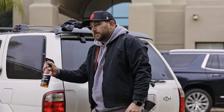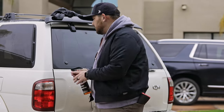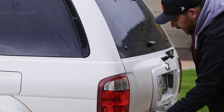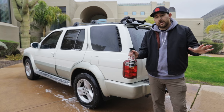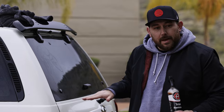Set my pressure washer down — I'm going to need that in a second. Then take the iron remover and blast the paint down. Mainly the paint; you don't really need to do the glass because iron will stick to it but won't embed itself. All the area I dried, I blast off with iron remover. The iron particles embedded in the paint start to react with the thioglycolate — the same chemical used in wheel cleaner to attack metallic brake dust. It starts to turn purple or bright pink, which is the thioglycolate melting away the iron particles embedded in the paint.